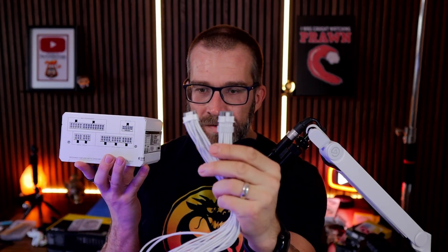This isn't necessarily an issue if you're using an NVIDIA GPU, because you can use the 12V 2x6 power connector. There's a separate cable included in the box for that — a 12V 2x6 on both ends that plugs into the PSU and into your NVIDIA 40 or 50 series card. Sorted, no problems. You then have a spare PCIe power connector and the two CPU power connectors available.